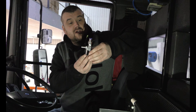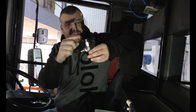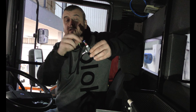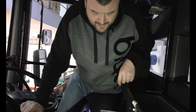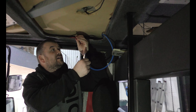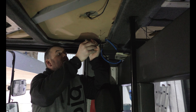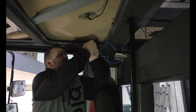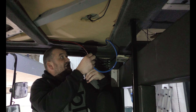Up in the front now we've got the solenoid - it's a 12 or 24 volt solenoid. The compressed air is going to come into here and when we press a button it opens up the valve and out shoots the air. That one's running to the back compressor and this hard nylon one is running to the horn on top. It's a nice push fit because I bought the right size connectors, but these are different sizes so it's going to be a tight fit.